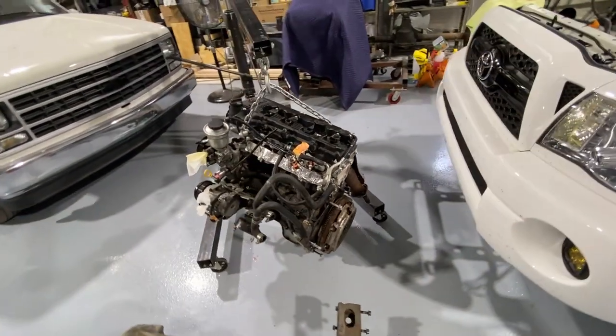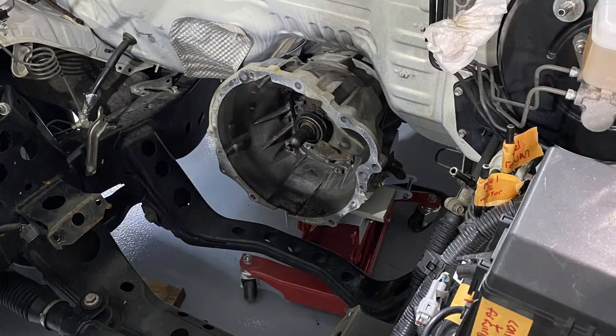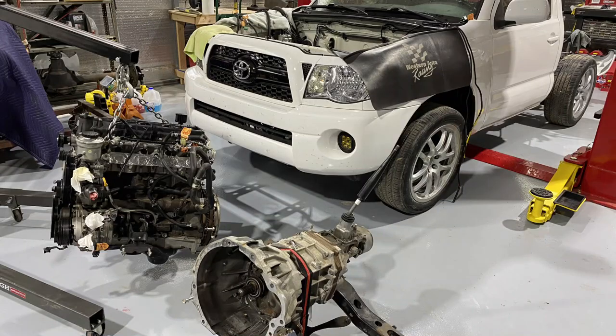The engine is out in one piece and it is available for sale, as is the transmission. Everything's out and labeled, and we're ready to proceed to the next step. I think the next step will probably be taking the 5.3 and mounting the clutch on it, getting that all set up in the bell housing to prepare it for installation, before we can start dropping it in and getting some measurements. Then we're going to look at having some motor mounts made. So I hope you learned something — we're making progress on this truck, it's going to be pretty cool. Thanks for watching, we'll see you next time.